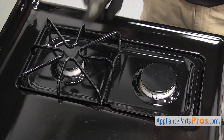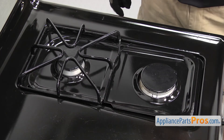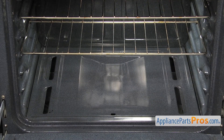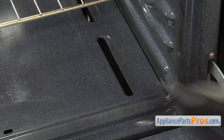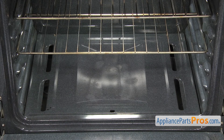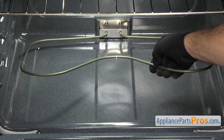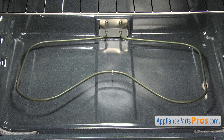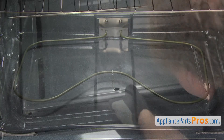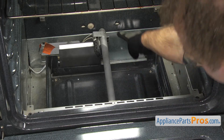On gas cooktops, wrapping the grates, burner heads, or drip pans in foil can cause heat retention, carbon monoxide poisoning, as well as starting a fire. In general, you'll want to avoid lining the oven with foil because it could block air passages, causing heat buildup that causes poor cooking and increases the danger of a fire. If the foil gets too hot, it could melt, damaging the oven lining or starting a fire. With electric ovens, putting foil under the element could cause heat to be reflected back into the oven, overcooking the food and possibly damaging the element. If the foil touches the element, it could become a shock hazard. In gas ovens, blocking air passages could affect the burner operation, causing poor cooking and carbon monoxide poisoning.